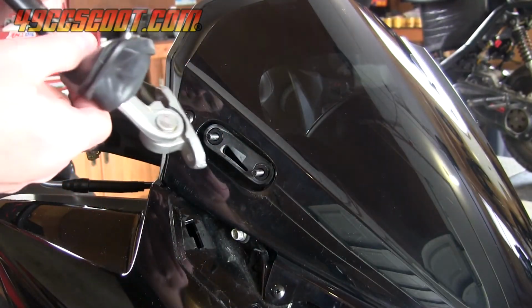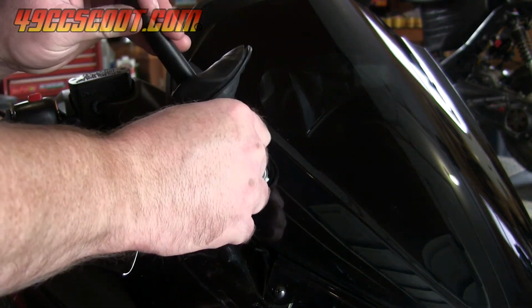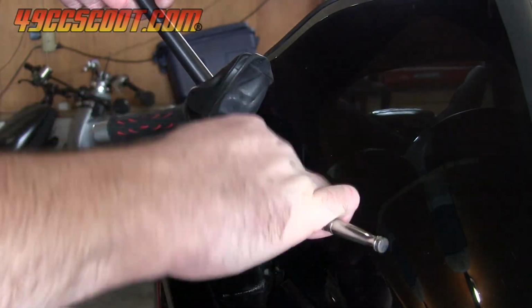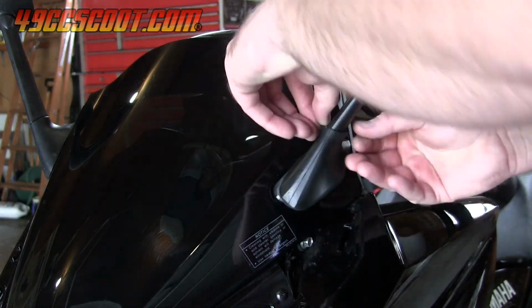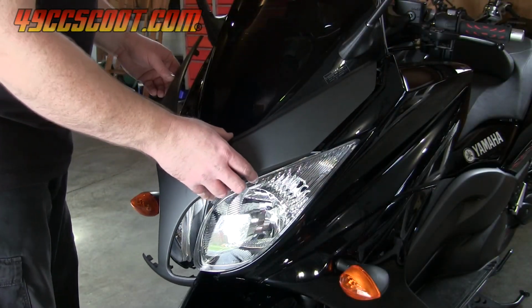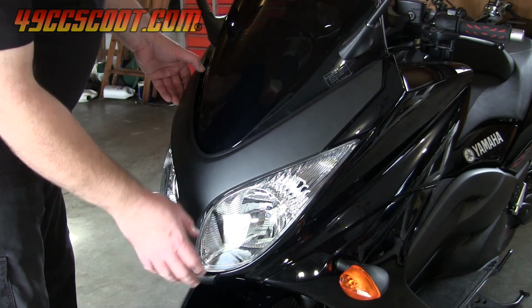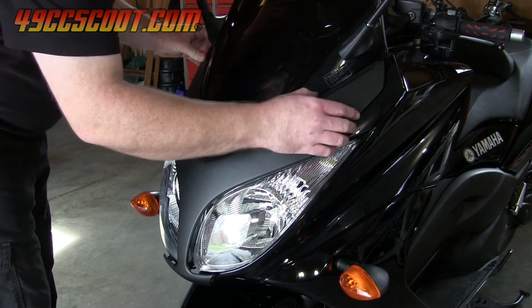Once that panel was on, both mirrors were reinstalled by sliding them straight over the studs and securing them with nuts. Then the grommets were maneuvered back into position so they fit into the tinted panel. Finally, the Y-shaped panel was reinstalled, beginning by lining its clips and pegs up with their receivers and pressing it into place all around the top of the Y.